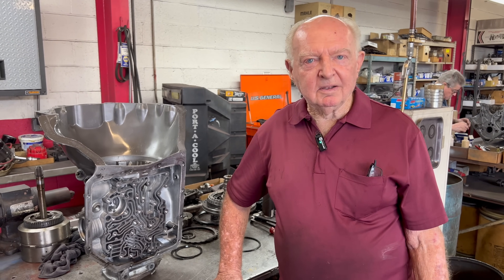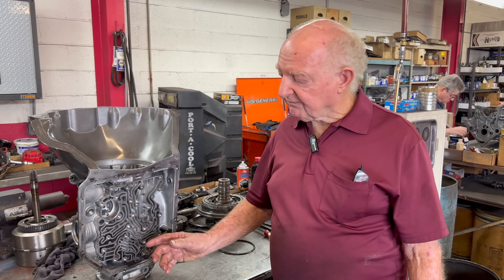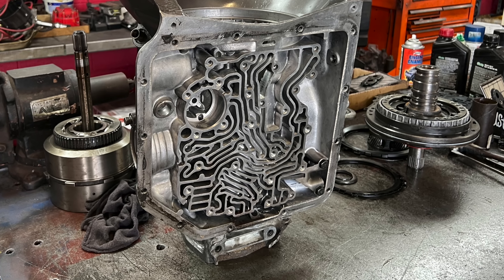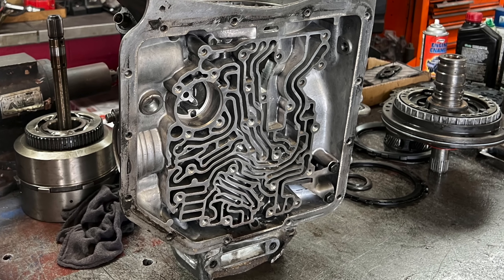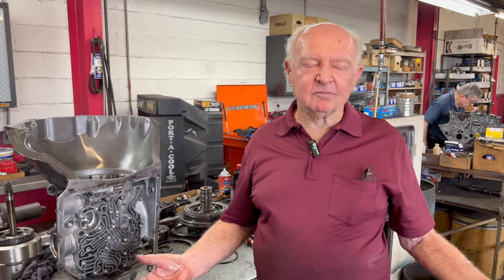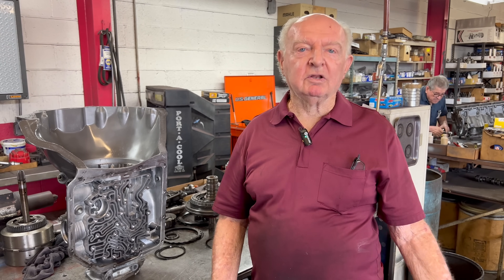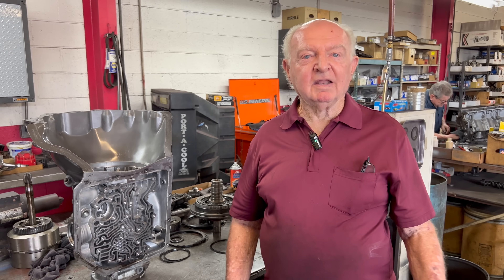After that I came to Arizona, and shift kits were not really available. The other guy here, Al Young — him and I got together and spent a lot of time tracing valve bodies by hand. Years ago we printed them by hand, copied them, and then I hand-wrote out the shift kits with a pencil. How did you figure it out? Just common sense. We left some steel balls out, did different things, blocked the pressure relief valve to get them to work. Sometimes you drill a hole and the oil goes to a clutch — shifts real good — but you've got to get that oil out of that clutch too when it shifts to the next gear.